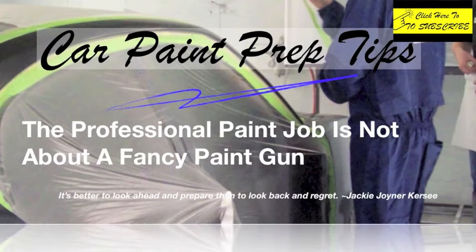And one of the first things that you want to do is wash your car. Washing is very important, but often skipped or overlooked. I mean, you get the car in, you just want to start working on it. You want to start sanding it, if you're just going to paint or if you're doing body work. However, when you're sanding all that, you're just sanding and smearing that silicone and wax and greases into the paint surface. And then whenever you go to wash it before you paint it, some of that doesn't come off too good. So it's always a good idea to wash the car before you do any work to it.